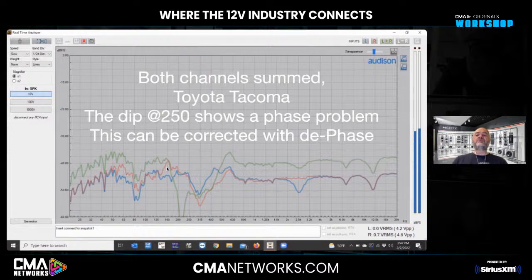It can be a huge time sink on the installation day because you're sitting there trying this over and over and thinking tape measures don't work. And that's not the case. The case would be that if all the channels aren't in phase with each other at every frequency, delay will not give us the results we expect.